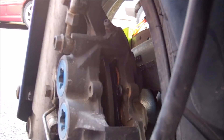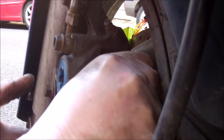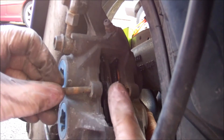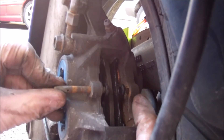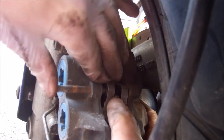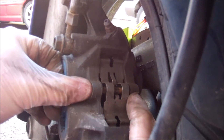As you can see, I didn't quite push the front pistons back far enough. The next part is to slide the pin in just halfway, because you still need to put the spring clip back on. Try and make sure that the holes, as you can see there, are facing up, because it'll be much easier to return the retaining clips. You'll need to get those all lined up, which can be a bit fiddly sometimes.